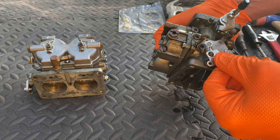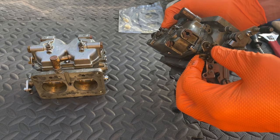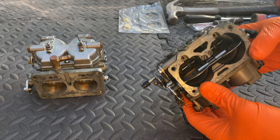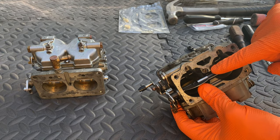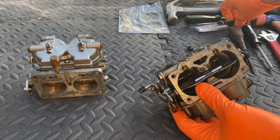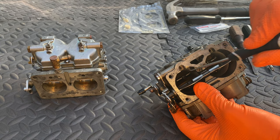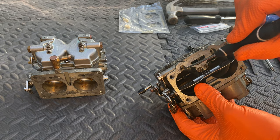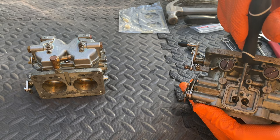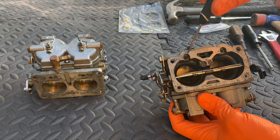You want to inspect some of these clips as well — see if they're damaged. These look very greasy but overall they're in pretty good shape. You can see some of our jets here. These are a number 60 size air jets — super small. Whereas these up here are the larger ones, labeled 290 on the upper ones, and over here these are labeled 6-0s.